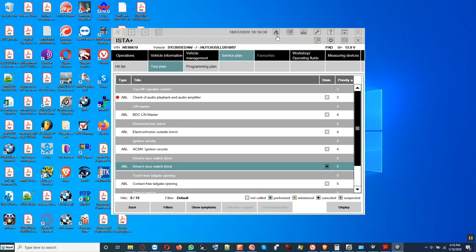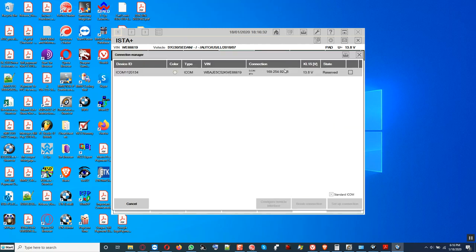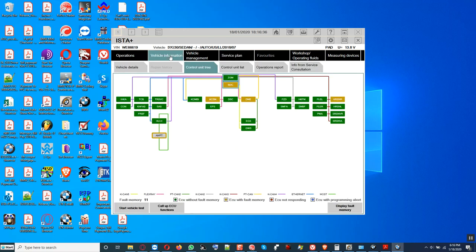The amplifier code already? You code the amplifier? No, I'm gonna do it now. Okay. But you have to go in now, the next one. Let me check which bus is on. Sometimes this is green. This would be on the PT CAN too. Let me see. This color here, does it match to this or this? This green color here matches PT CAN 2.